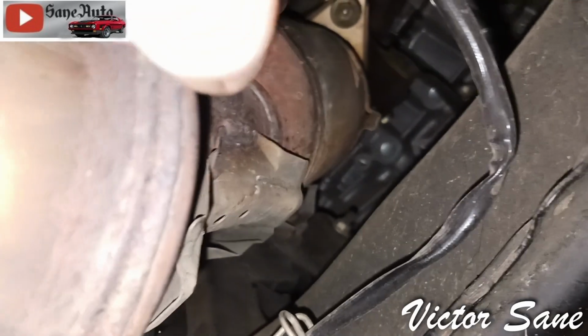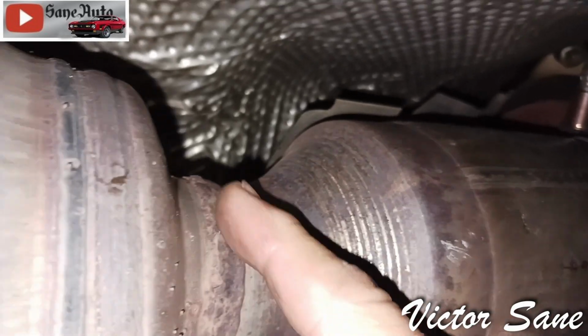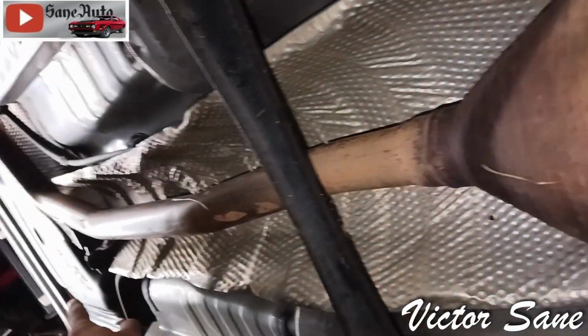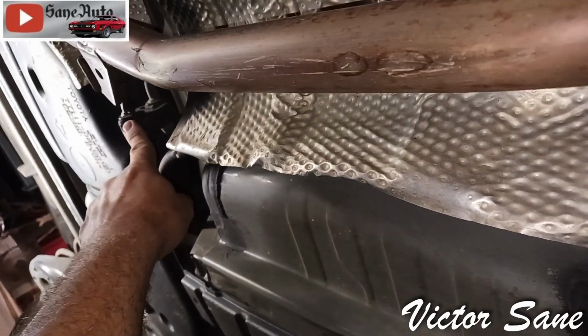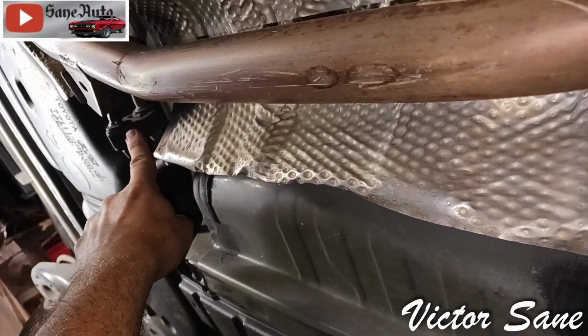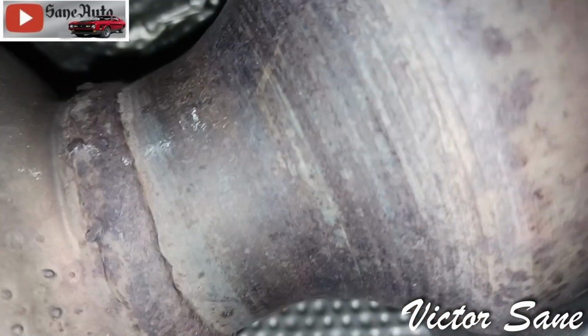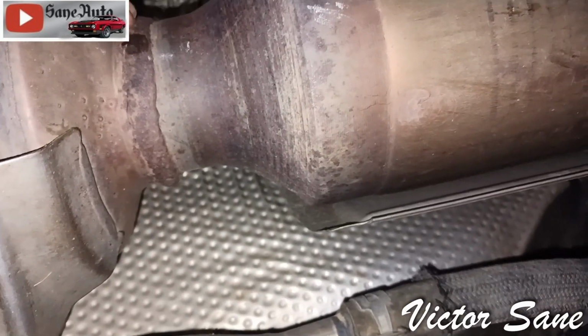And then when you measure from there to over here, you've got another 10 inches, a little bit less than 10 inches here. This has got some room, so you've still got some room here and over here that this all could move back a little bit. And I look back here and there's room back there. This is pulled toward forward, so it would actually be relaxed a little bit if it went back a little bit. And look back there at the muffler, that can also has room. It can go back a little bit, an inch or two. So if the new assembly does push this back an inch or two, it's not going to be a problem.